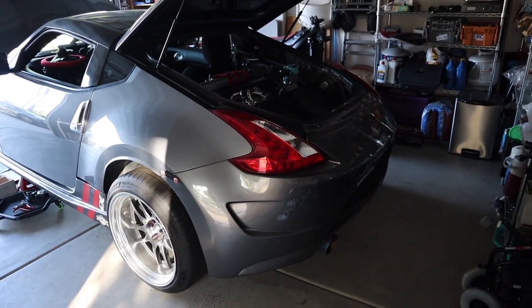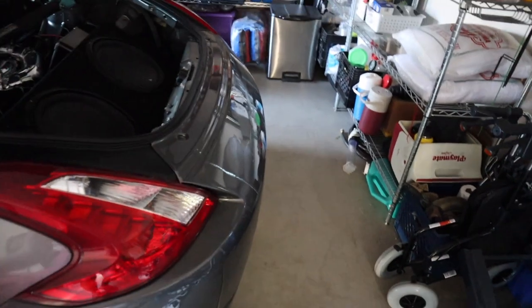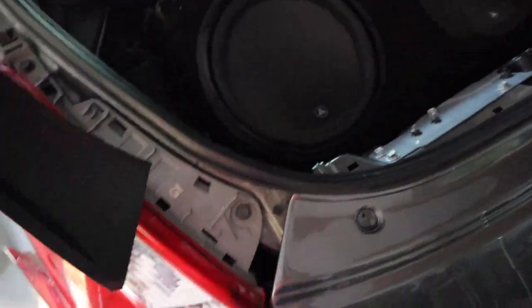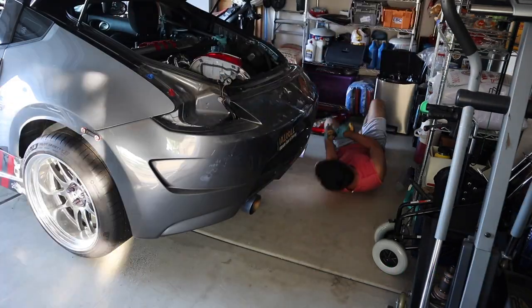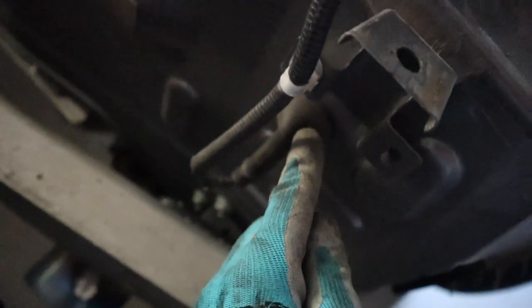Since I have to bring the wires through the bumper into the grommet and into the trunk, I need to remove the rear bumper. Remove the tabs, then remove the bolts — there's one inside too. First remove the taillights, then remove the bumper. We don't need to take the bumper fully off — we just need to run the wire. We'll go through this grommet, make an incision through it, run the wire from here all the way through, install the camera right there, and tuck the wire through.